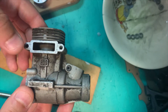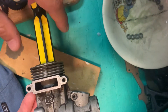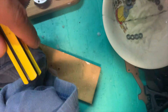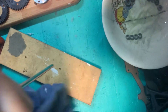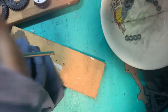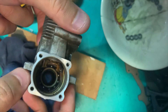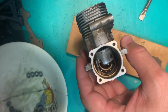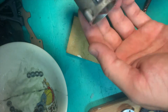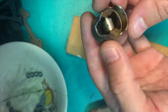In order to get that piston down, what we might do is just put the back of a screwdriver in there and see if we can knock it out. Put some protection on there so we don't destroy the piston completely, and then we'll just tap it. Looks like that piston came all the way down — it's sticking out the bottom. We just gave it one hard tap with the screwdriver and the piston has fallen down. Let's see if it comes out. Yep — that piston has had it.